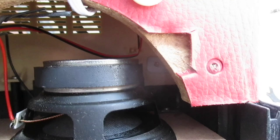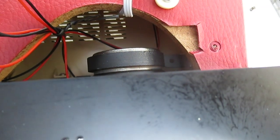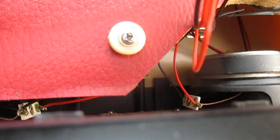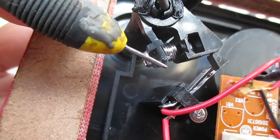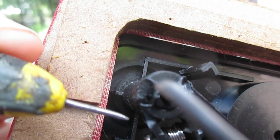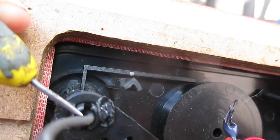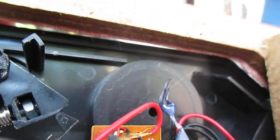You can see one of the speakers — it's got two of them, it's a stereo unit. Those speakers are a bit more substantial than what you normally see in a 21st century portable record player, and there are a couple of bass ports for whatever that's worth. Here's the auto-stop piece I had to break off — you can see how they melted it in place to hold it on the tone arm. Some later models had the tone arm wiring running out and used a screw to hold the auto-stop mechanism, which would have allowed repositioning it to work right.